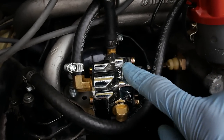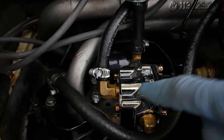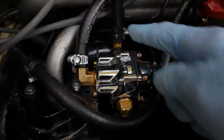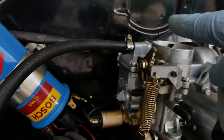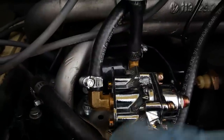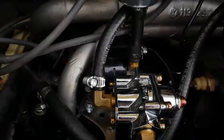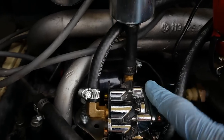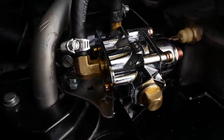Here's my install. This is the regulator here — the line comes in from the pump into the bottom of the regulator. I locked off and plugged one side, and on the other side I put a 90-degree fitting that goes out and up all the way to the carburetor. I mounted it the same way I did the previous regulator, on a screw — one of the tin screws. It's pretty solid, not going anywhere, and the bracket is back there as well.